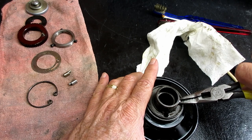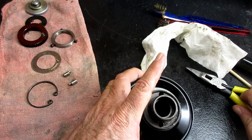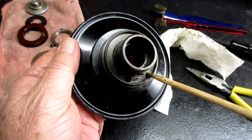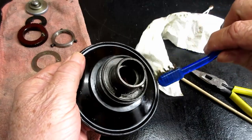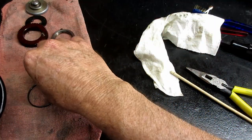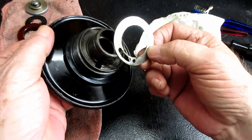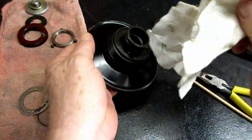This is the middle pin — it's in there tight and I'm not going to force it. I can see the large holes where the other pins went in, but this one doesn't seem to have that. This center pin is permanent — it's what the spring hooks onto, and the hole in the spring retaining washer slips over it too. The other two came out. I'm glad I found that out now, not while cleaning it in a sink where they could go down the drain.